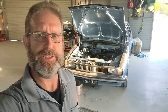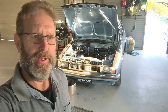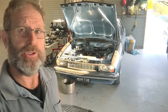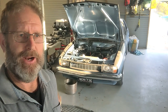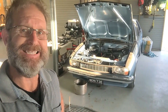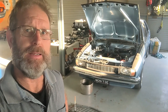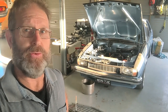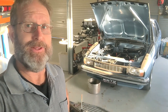That's where I'm up to at the moment - an update on all the changes, modifications, and parts since I pulled it apart. The last phase was pulling the head off to get it CC'd for the compression ratio, and that's when I found those worn lifters - a bit of a shocker. The engine builder said not only is the cam probably damaged, but that fine metal that wore off has gone right through everything - into the barrels, into the bearings. The bottom end needs a good cleanup and probably some new bearings.